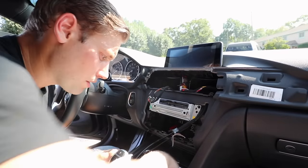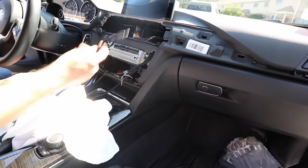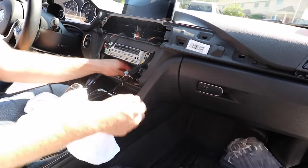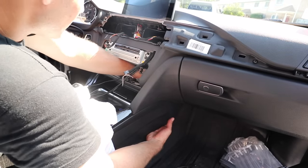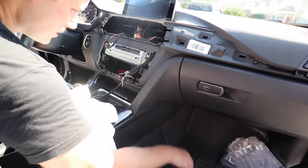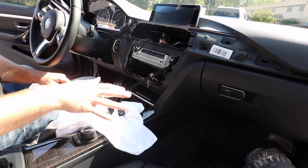If you're running a SmartView, you'll have the other end of those RCA cables. Reach your hand down here and up under the trim — typically you can do this without any special wire feeding tools. Pull this out down toward the bottom. Once you've run your audio cable, just let it hang and we'll get back to that in a second.